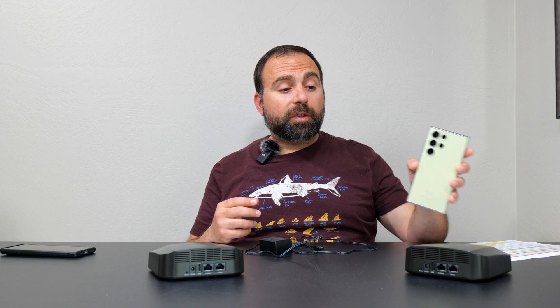Number two: what is wired backhaul, otherwise known as Ethernet backhaul? Wired backhaul literally means that two nodes are connected to each other via Ethernet, which ensures the secondary one is getting really good speeds. Because it's not always convenient, they also have wireless backhaul, where the satellite wirelessly talks to the router to increase coverage. However, wireless is typically not quite as fast as a wired Ethernet cable. During my speed tests, when I say wired and wireless backhaul, I'm doing the speed test from the secondary device to the main one.